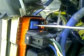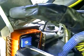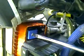With the ignition on, slowly adjust the dial counterclockwise to advance the ignition timing. Take note of the red LED — when you turn counterclockwise, the red LED stays off, which means you have advanced the ignition timing. The maximum advance is up to four degrees.